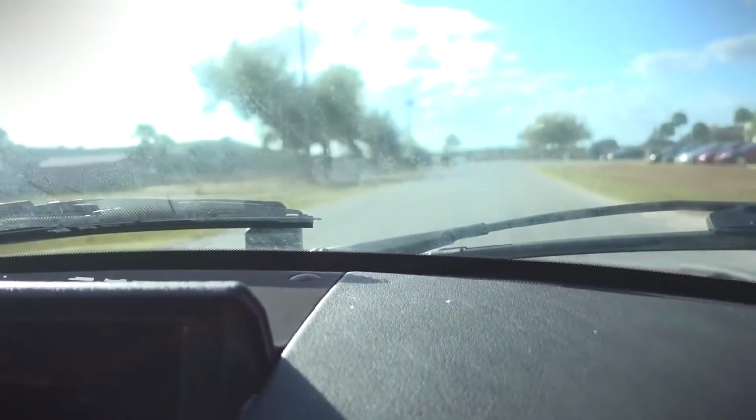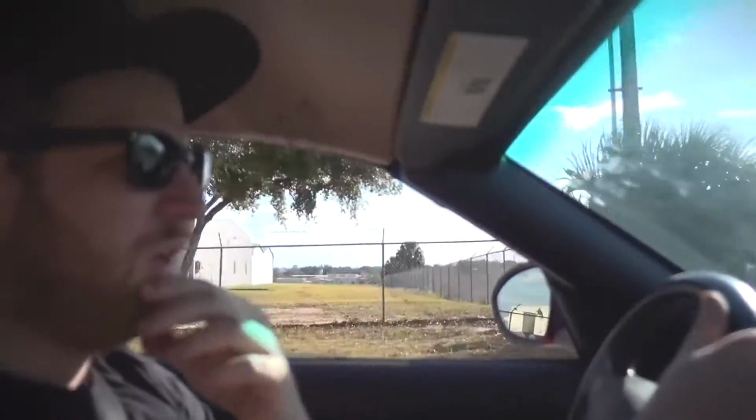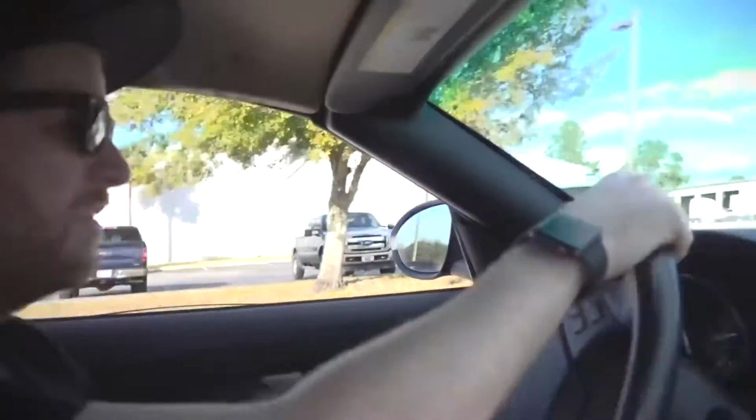That sounds like a lot of stuff going on and no speed. So slow. It is very slow. I think that there's a boost leak. You just turn around and go back. Okay. Yeah, I think there's a boost leak there too. I haven't had a car go 0 to 40 that slowly ever. Well, it didn't want to go past 3,500 RPM.